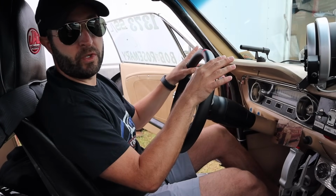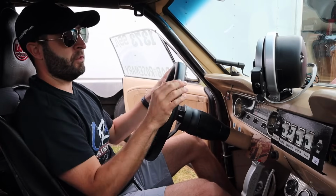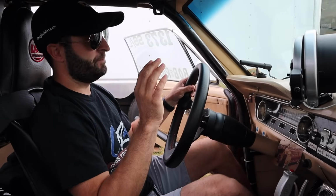I move my left foot over to the brake pedal, 2 hands on the wheel, and I'm looking for the other guy. If it's an elimination run, I'm looking for the other guy. If it's qualifying, I keep everything in place. I check some gauges and go on about my run. When I go through the finish line, shove the clutch in and I shut the ignition off. That way, if I want to read any plugs, I can get a nice accurate reading.